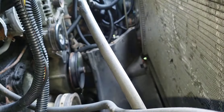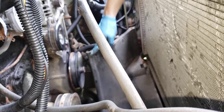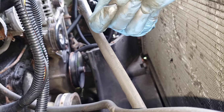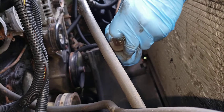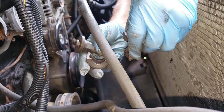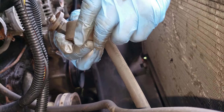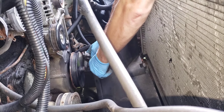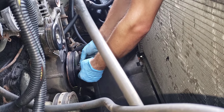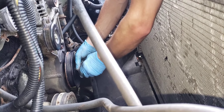I use this tool after lubing the backside and the front. Put the 5/8 shaft through this. You have your coupler remover tool — there's a small end and a bigger end. You put the small end over the pump, like so. And you put your locking clip, or the coupler, on.